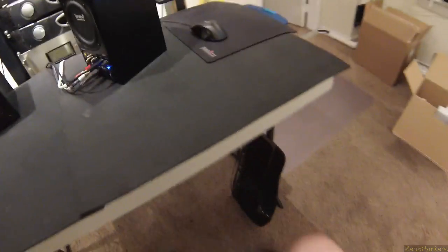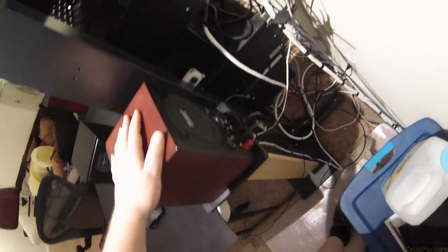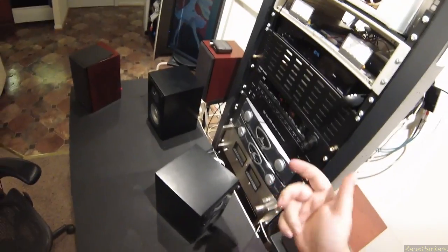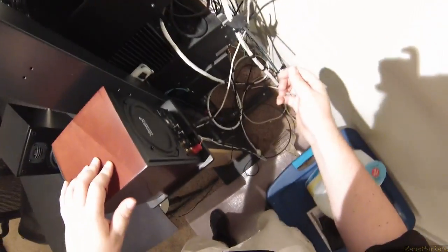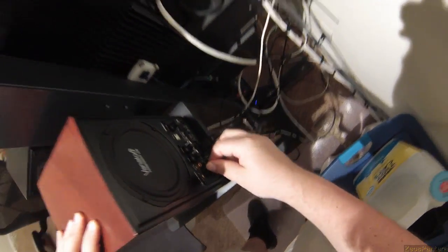Now, how do I know that? Well, when I go to do my near field surround sound, where I pull this table out and have all the stands around this chair, and I put the monitor in the middle, and then I watch Dread with these. My surround sound receiver here, the Tascam, has full analog outputs for every channel. Left, right, surround left, right, back, left, right, subwoofer, everything's analog output. So I have labeled analog inputs pushed in right here that go to these speakers.